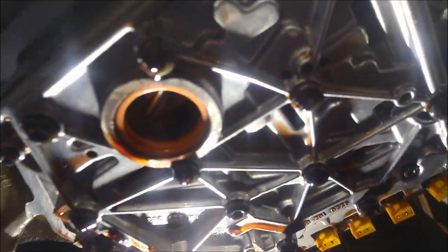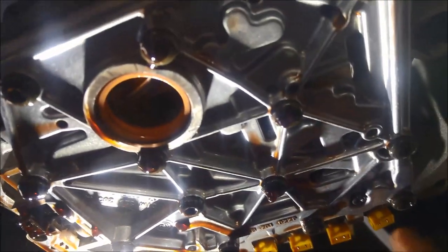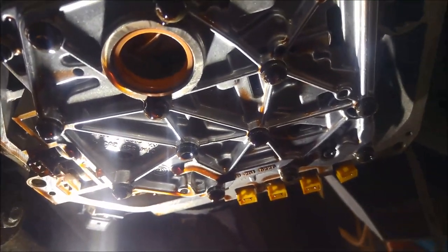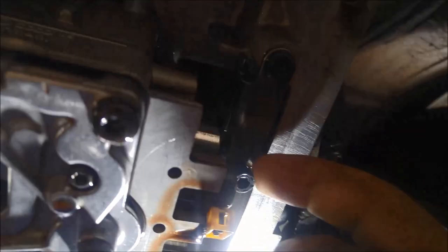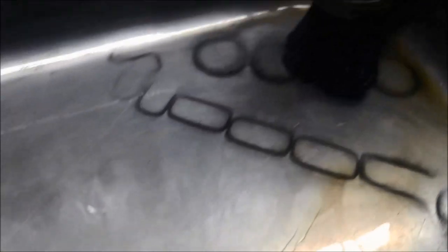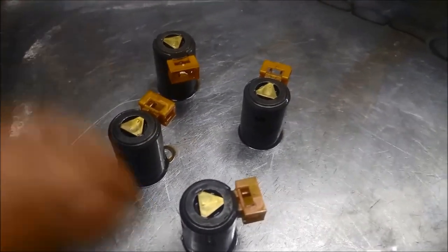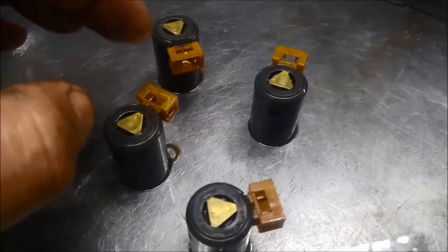What I might also do is just flush, de-magnetize, and flush these other ones as well. I've just washed them and you can see how much muck has come off in the wash tray. I'll wipe that up and then de-magnetize these and wash them again. That's without any air pressure or anything like that to flush out any of that muck. By de-magnetizing you'll get a lot more rubbish out of the solenoid.